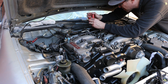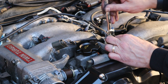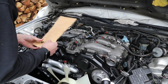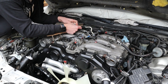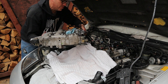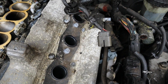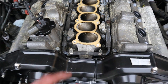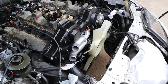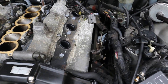We got most of this unhooked from working on the timing belt. We had to pull some of the spark plugs so some of this should come out fairly easily. After all of that we should be able to get this manifold out. So we've got the intake manifold off and just take a look how corroded, oxidized, and dirty underneath is. We want to make sure we fill in the intake ports with some towels and might as well take a look inside them — get out the bore scope, look into the cylinders and intake runners, and see what the internals look like.